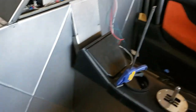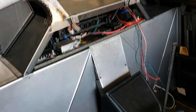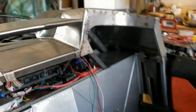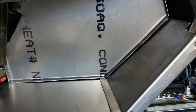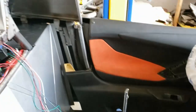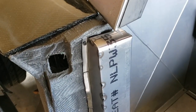Most of what I've been doing is here in the interior. You can see we've done a lot of metal work — the rear firewall is very close to finished. The electronics are in there; it might seem a little tight but it's actually a lot easier to work on. I still have a little bit to do in the cubby over there, but that cubby is close to being finished. We got the sidewalls for the console in. The melamine I had there was just temporary, and we got the floor pans in on both sides. I need some more steel for the other side of the console, then we'll get the B pillars roughed in, and hopefully we can start on the doors and latches — that's what I have on my list next.